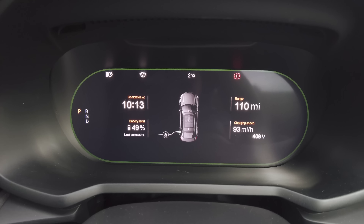BP Pulse has come up with a good system placing 50 kilowatt chargers in locations where you might spend more time eating — here you get 90 minutes before a penalty. If you arrive at 10-20% and sit down for a meal, you'll be good to go when done. If you charge mainly at home and just occasionally on the road, the Polestar is great. It will charge on 150 kilowatt chargers — best I managed was 110 kilowatts — but in the cold you won't get the full 150.